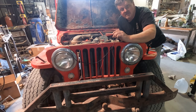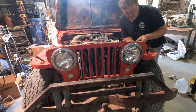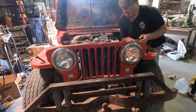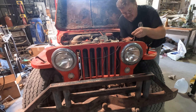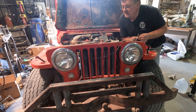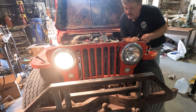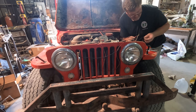I'm using my meter on the 10-amp setting to hook power to this because it will act like a jumper wire, and then I'll know how much power it draws so I know how much I need to put into it. We've got a light that is a little under 3 amps. Another beam — that one is 4.5 amps, so that must be the high beam. Now the other side, I'm getting nothing, so we probably have a burned-out filament. Let's try the next one — we've got 8 amps, so that is probably the high beam on that side. And the wire is getting hot.